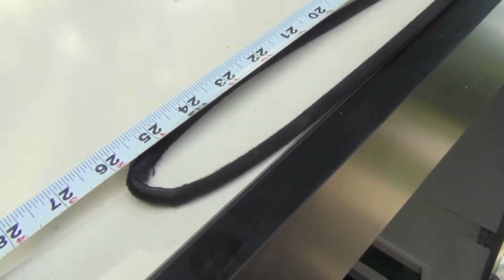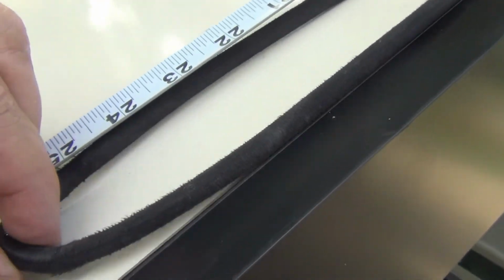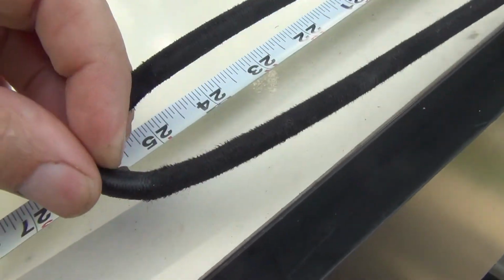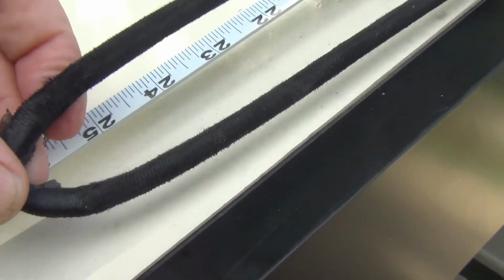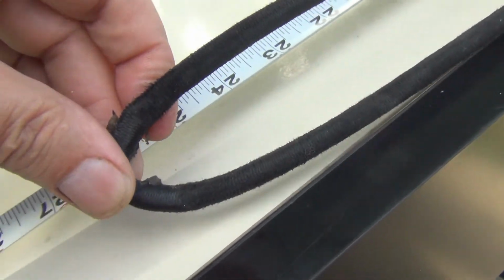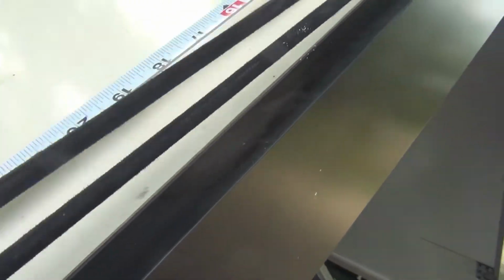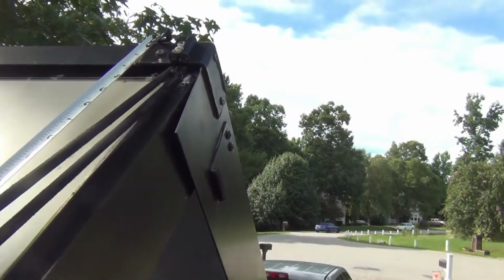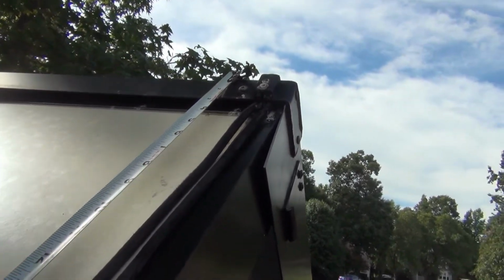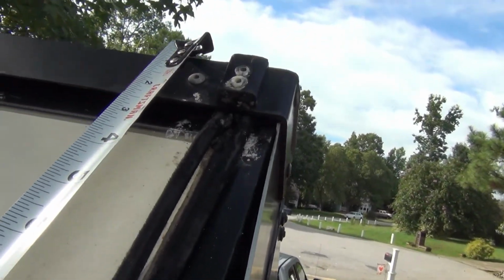You just need to have a little tension to hold the front and the rear roofs together when you raise or lower them. The actual lifting power is provided by the 4 roof springs, not the little bungee cords. I've already drilled out these bottom mount rivets when I installed the new roof springs. Now I have to go back to the top here and drill out these top rivets. So I'll go down and get my cordless drill with a 3/16 inch drill bit and get these removed.